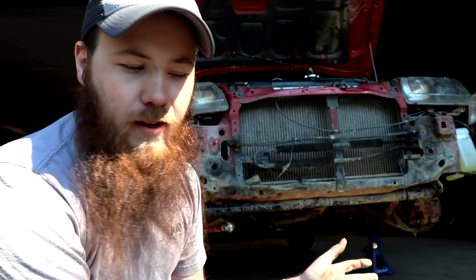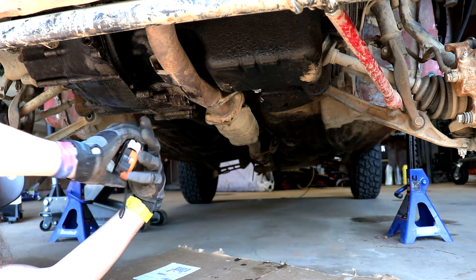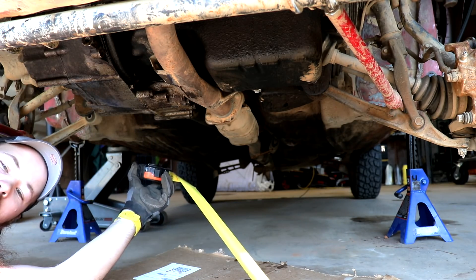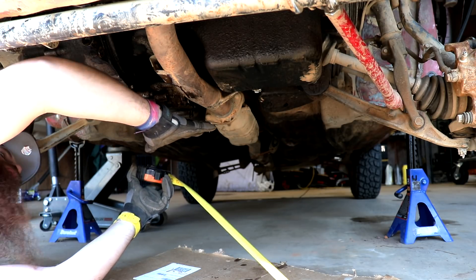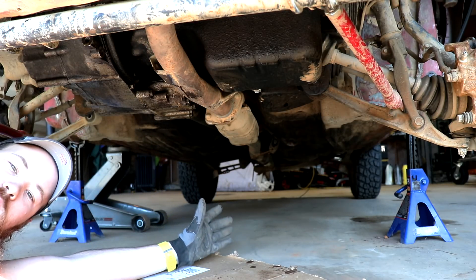Primarily the goal of the skid plate is to mitigate any damage to the oil pan, transmission, or anything underneath that's vital to getting home. Being a wagon going off-roading, there's a lot of potential for a large log or a rock to come up and smack the oil pan, put a crease into it, and leak all the oil out. I don't want that to happen. So now I'm going to measure between the two lower subframe bolts to see how long my crossbar needs to be. I'm going to reference that as my height so it's not up against the exhaust or transmission. I'll leave about an inch gap — it's looking like about 27 inches, so I'll probably cut it to 28 and a half to give myself a little lee room.